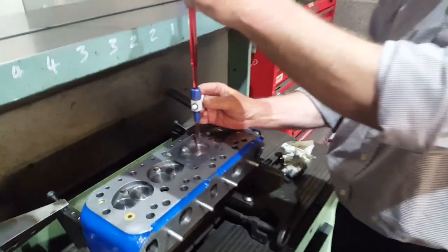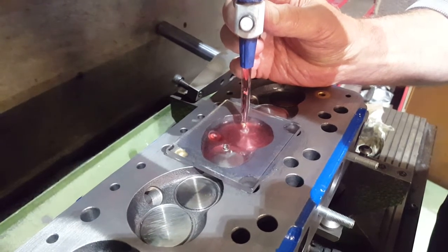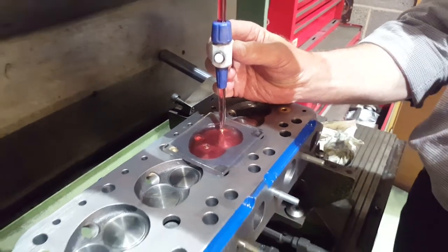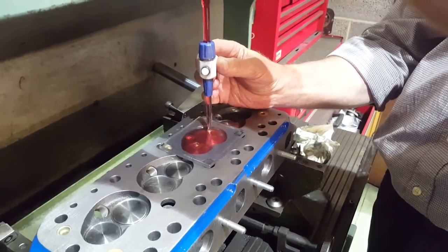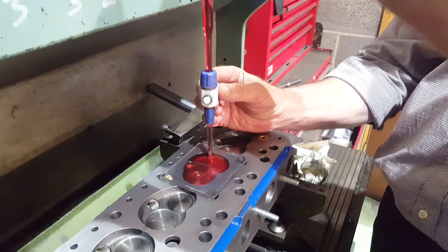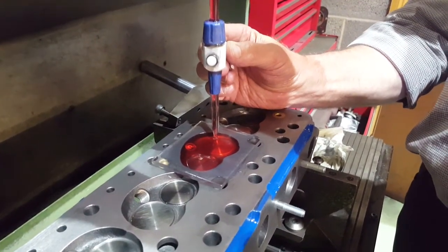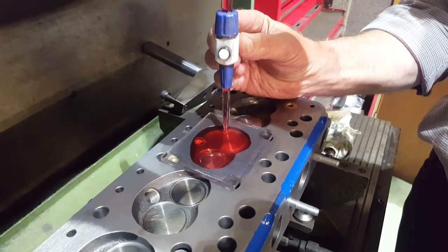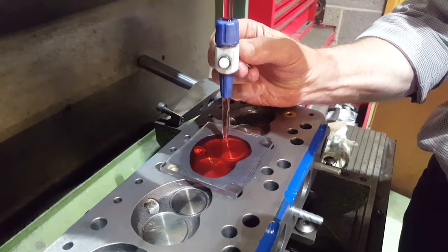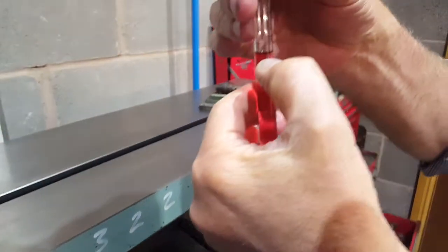It's a brand-new MPI plastic — this is the fluid going in. You'll see it going in now, gradually filling up. You will see an actual bubble appear on the underside of the perspex plate once it's filled up. We've got to get this right, otherwise it'll overfill. You can see the bubble coming up now — we'll slow the actual fluid down. There's the fluid coming up to the bubble. So that is it — that is full now. And we read off: this one is 22.4 cc.